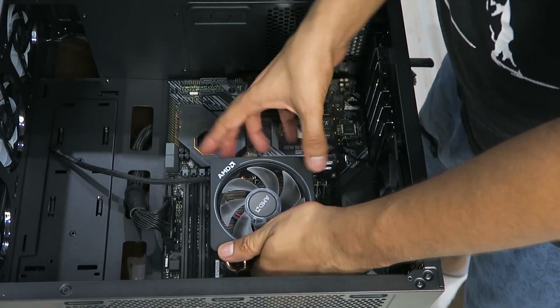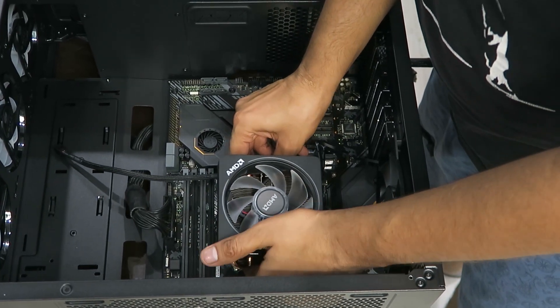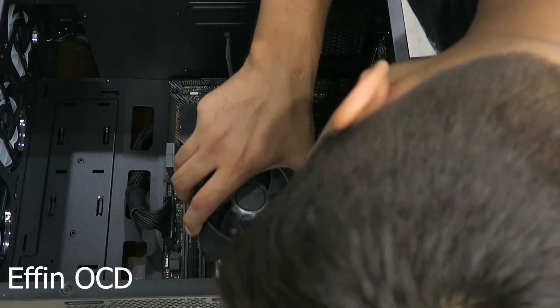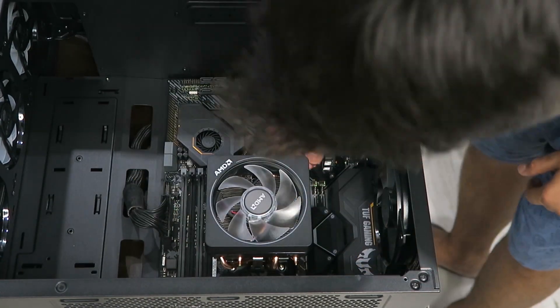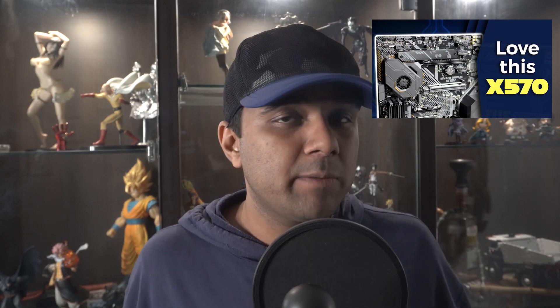Pinning in the stock CPU cooler was extremely easy. There was thermal paste already on the base of it, so no extra paste was needed — though I had to take it out once to see how it was applied, or maybe that was just my OCD. Make sure to connect the CPU fan cable to the pins labeled CPU_FAN on the motherboard. I've also made an in-depth video on this motherboard; the link is in the description.